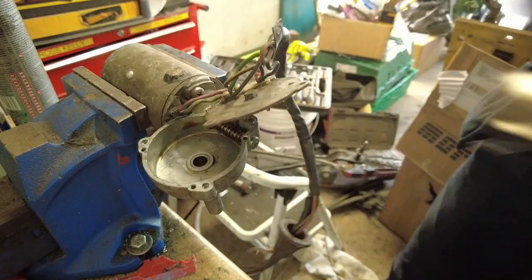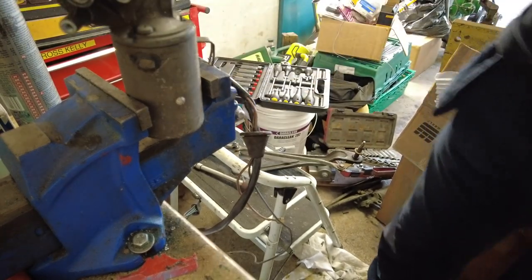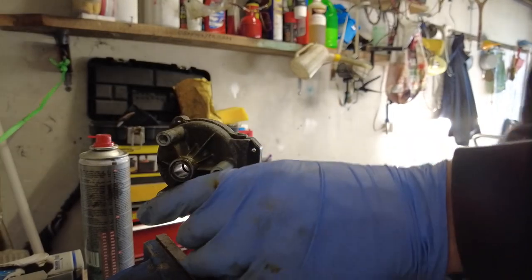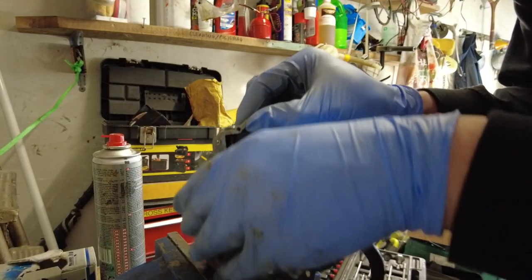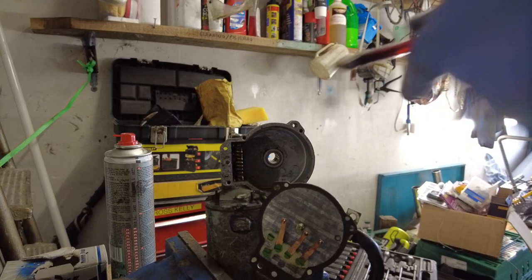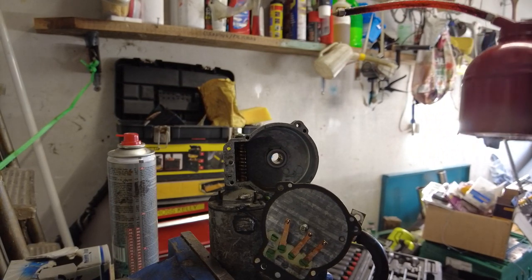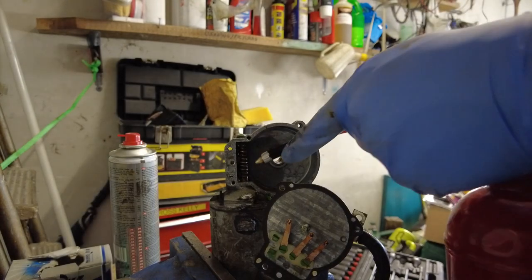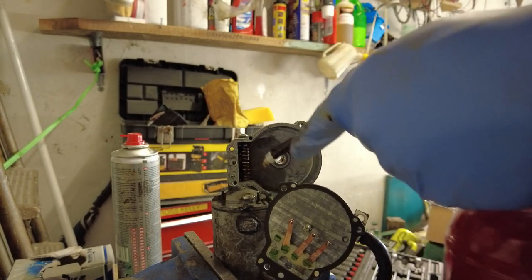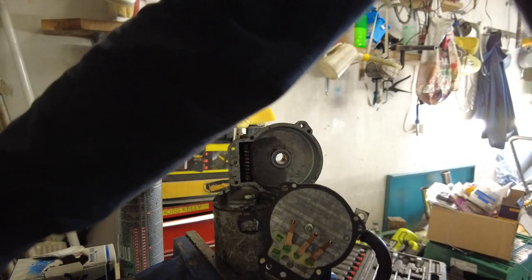What I'm actually going to do before I go any further is turn that up and instead of putting grease down there I'm going to put some light machine oil down there, and if we need to then we can look at getting into the motor itself. Motors are not all that complicated — it's generally worthwhile to try and fix the motor before replacing it, so that's exactly what I'm doing. What I have in this squirty bottle is damper oil from restoring the lever arm dampers on the front suspension of my MG, and it'll do absolutely fine for my purposes here.